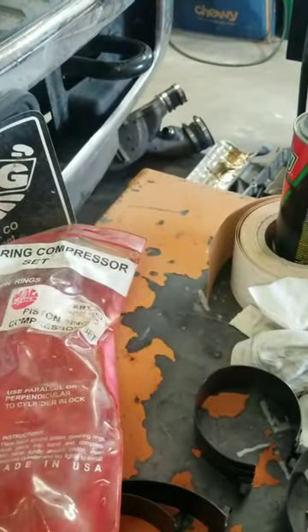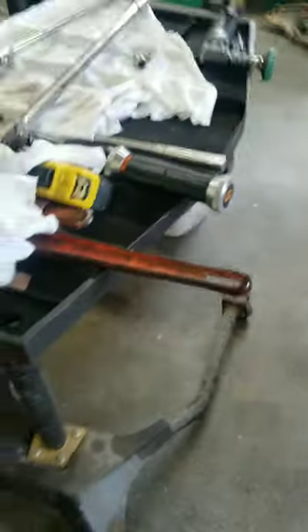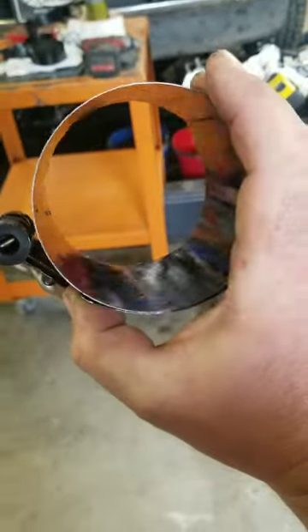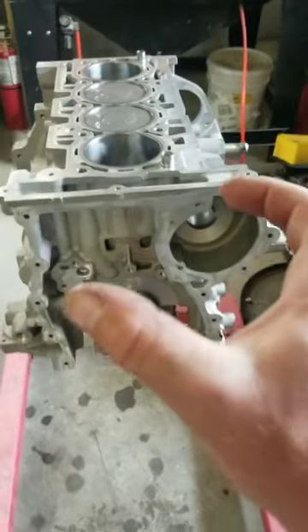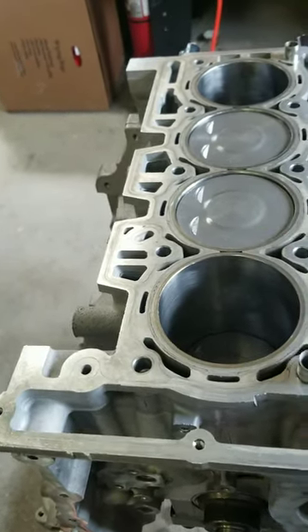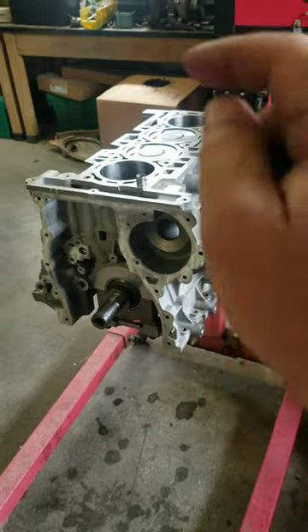I busted out this Mac Tools ring compressor — I've had it around for a while. Piece of shit. Don't use plier types on rings. It was the only one I had for this size, so I oiled the hell out of it and it did work. Last time I built an engine I vowed I was going to buy an ARP or conical spring compressor — just one piece — and I forgot to do it on this one. Every time I build an engine I'm going to buy the specific ring compressor for it — 50 to 70 bucks.